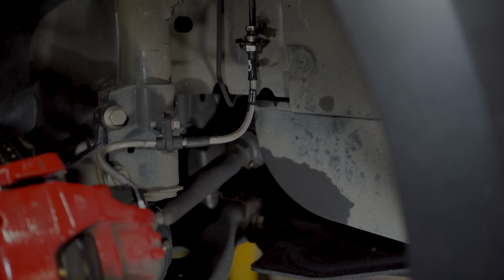To begin, firstly ensure that the handbrake is off and begin undoing the two bolts that hold the caliper onto the caliper bracket. We can't push the pads back into the rear because they require winding, but the caliper should come off easily enough. Just like the fronts, you've got a further two bolts at the rear of the caliper bracket, and that will be removed too.